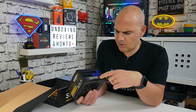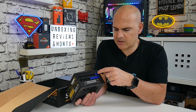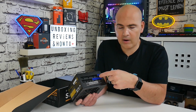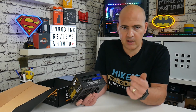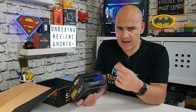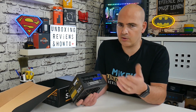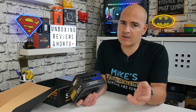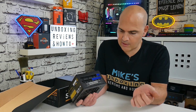Moving along the side, you've got the blue ones. These are all for your PCI Express. You'll notice on here you actually have 4 outputs, which is a slight upgrade from what you'd see on the EVGA G3, which has only got 2 outputs and then uses a doubler on the cable itself to allow the power if you wanted to use 2 graphics cards, which for some people isn't ideal. They prefer to have a separate power output for each individual input on the graphics card.